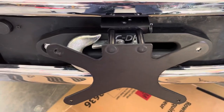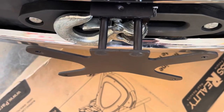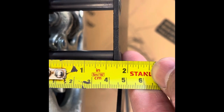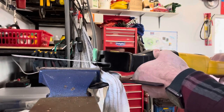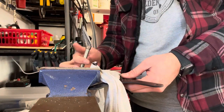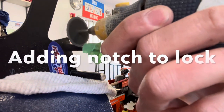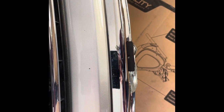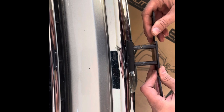With the plate on, I realize there's too much of a gap, so I'm going to attempt to modify it to not stick out quite so far off the truck. I figure I'll take off about one and a quarter inches — it'll still stick out a wee bit, but not too much. Here's my modification — I'm going to give it a try and see how it fits. Perfect, it locks into place, it's not coming out, and it's not sticking out nearly as far.